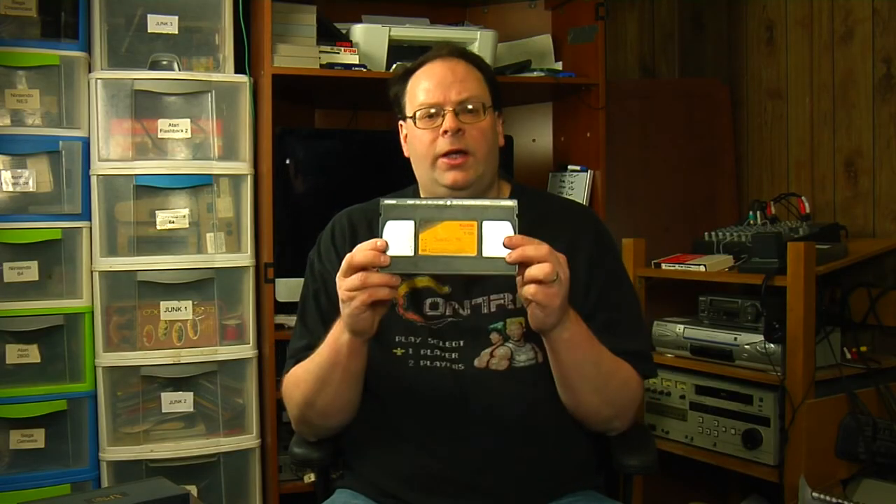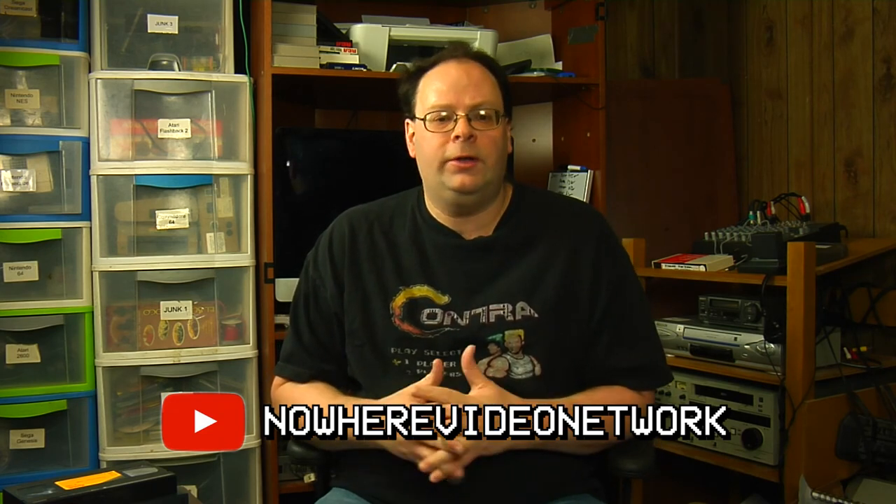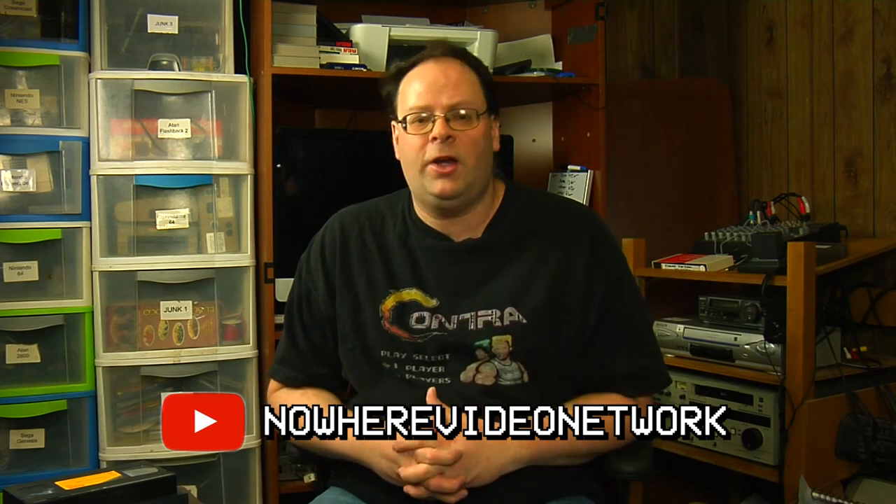That's going to do it — we now have a completed repaired tape that I can continue capturing the footage off of. Word of advice: if you have a tape that you've repaired, try to avoid running it at high speed — like high-speed rewind or search functions — anything that runs the tape at a high rate of speed. It could very well snap again, so you want to treat this as a fragile item, at least up until the point where you've got your footage captured. I hope you found this video informative and interesting. Please like and subscribe to Nowhere Video Network on YouTube — that is Nowhere Video Productions' exclusive YouTube channel. Also check us out on Facebook, Instagram, and Twitter. Once again I'm Todd Hilton for Nowhere Video Productions — thank you for watching.